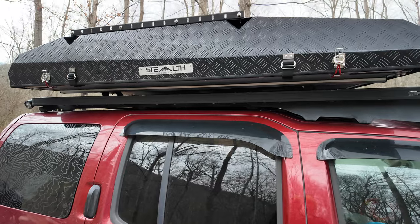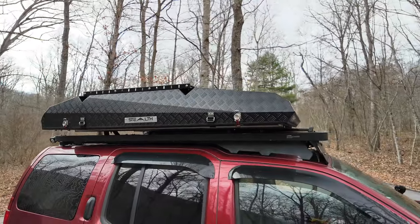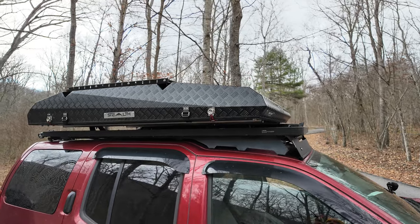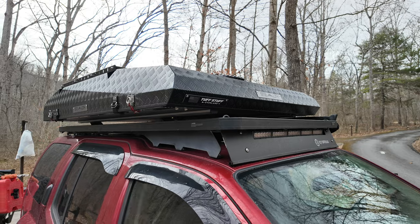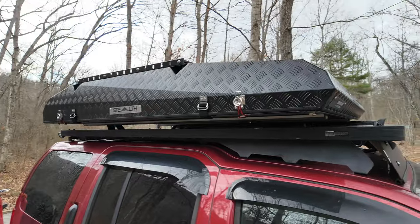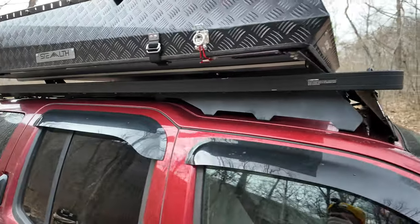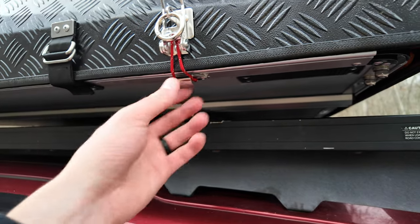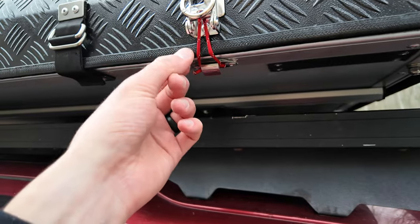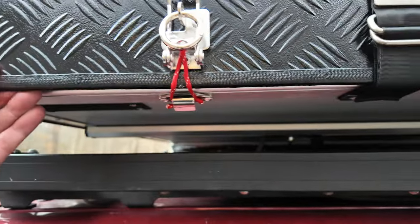One improvement I made: the tension strap goes from left to right side and pulls the canvas in as you close the tent. It came as one piece with a lead hanging down, so I cut it in half and added two connectors so I can just unhook it when opening and clip the two connectors right onto the rail — no extra trips up and down. I also replaced the stock metal bolt retention piece, which was digging into the rubber and not keeping things uniform, with 550 cord. It's much stronger, much tighter, and keeps everything more rigid.